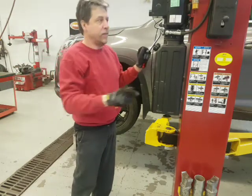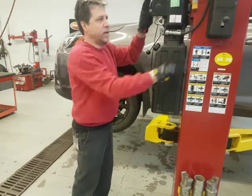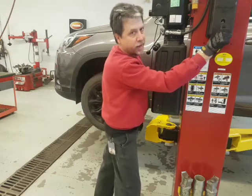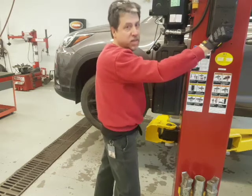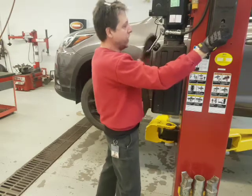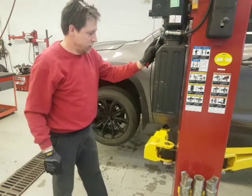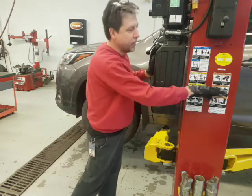To get it off the safety, we have to raise it just a little bit, and then pull the safety down. When this is all the way down, I mean all the way down, if you come just a little bit down, the other side could catch, the vehicle would be sideways, and that would be a bad thing. You're going to take the safety off, all the way down, you can go past the safety. If you wanted to re-engage the safety, let go, and it will find the next welded puck. They're fairly steady, you can hear them clicking past it.